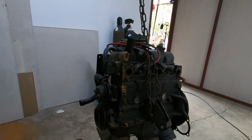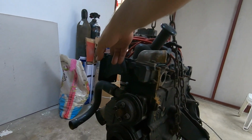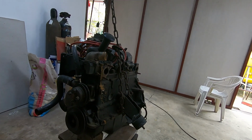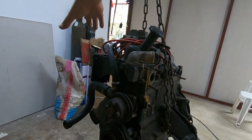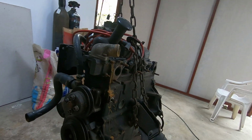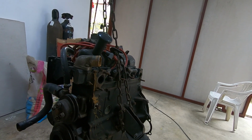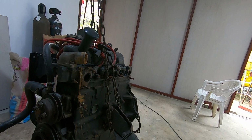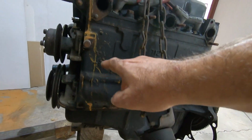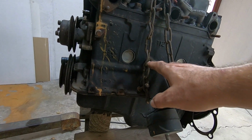But anyway, because this was in the Capri and it's going in the Escort, I can't have the air compressor here because of the tower for the brake. It's right-hand drive, obviously, and the tower comes up here, and the master cylinder and whatnot. The reservoir is up here. So we're going to use the bracket, compressor, and alternator setup that's on the Escort at the moment, which all bolts here. Looking at where that bolts, it takes up those 3 points there, and it might well spill over to here, I'm not sure, can't remember, we'll find out.